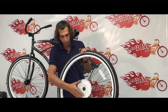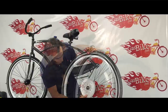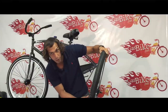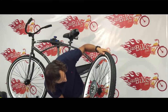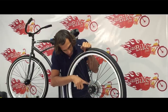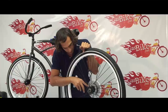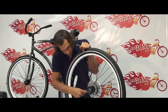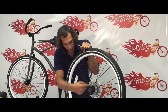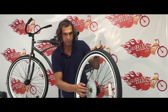Before you start tightening down all the bolts, you want to make sure that the sprocket is right in the center of the hub. Try to line it up as best you can, because if you don't, your sprocket will be off-center, and that will cause your chain to fall off. Tighten the center screw in every half-moon area first. So if there are three screws in a half-moon area, do the center screw first, then move to the next center screw, and so on. Then move on to the ones in front of every one you just tightened — that way you'll evenly distribute the force. Always constantly check that your axle is in the center.